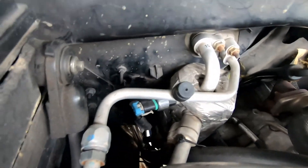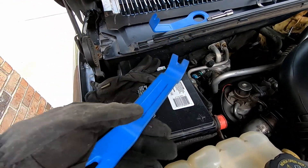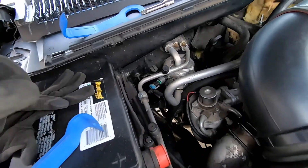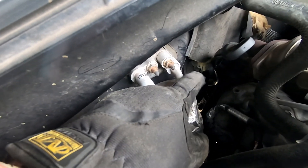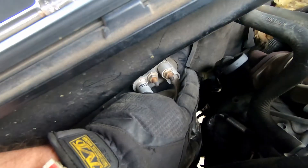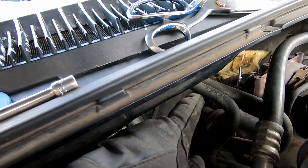You'll see some threads on this little stud back here — it's the second stud, not the one up front, the one behind it. Basically there's a little plastic clip. I got the trim removal tool, put it behind the stud, got the plastic piece off, pulled it toward me, and was able to get the chunk of the firewall blanket off along with that plastic fitting. I actually ended up just cutting the firewall blanket out with a sharp pair of scissors. Behind the passenger side, behind the AC accumulator, it's maybe six or seven inches — just cut that and pull it out.